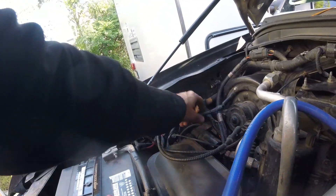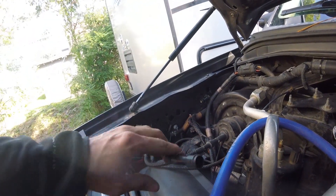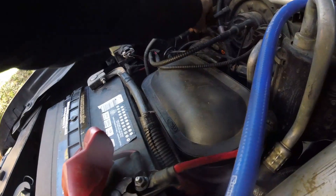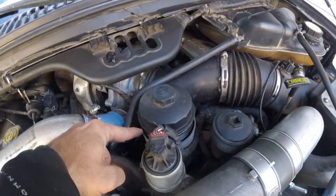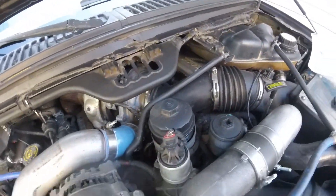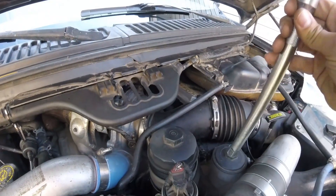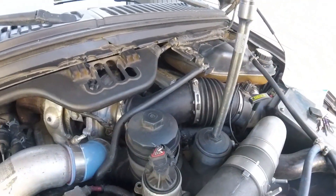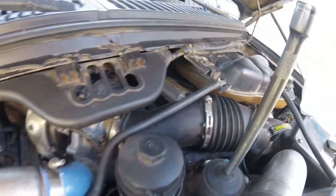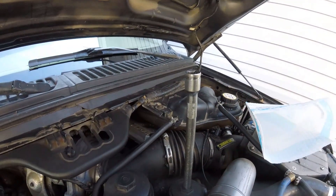Make sure your batteries are good and charged. What you're gonna do is touch that wire to that battery terminal right there. While you look in here, you need an extension to press down on this relief valve — you basically just push down on it like that and it keeps the oil from coming out. Let me get a rag in here so oil doesn't go everywhere.